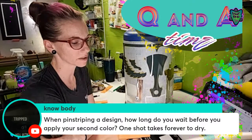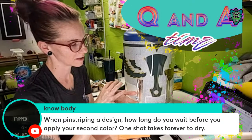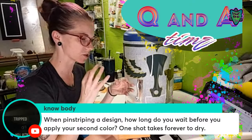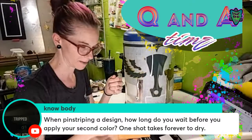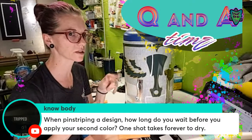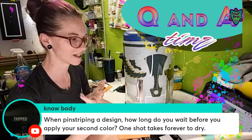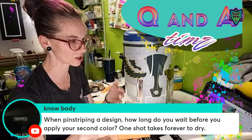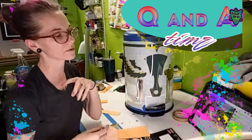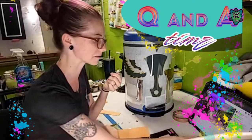When you paint, you'll get that feel where you've got your brush consistency, your paint consistency just right. You gotta pull the line, be dedicated to pulling it once and be done with it. Sometimes you can go over it two to three times, but you can't have too much reducer on it. You can't have too little paint on your brush. You gotta have that perfect drag where the paint will go over it without pulling the last line up, and same thing with lettering.